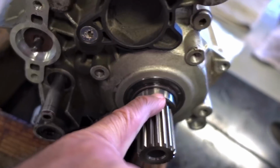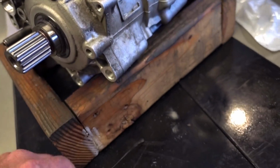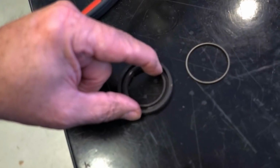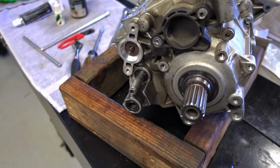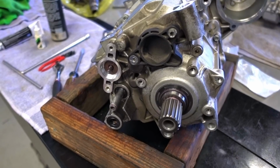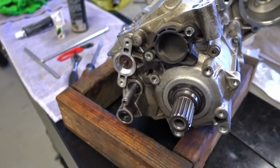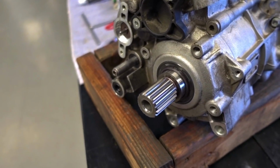The inside of the seal, that red you see, is a long-lasting kind of treatment they give them. Well, when they flip, it knocks the tensioning spring that rides inside the seal. So that spring is now laying on the shaft inside there, and it damages the seal to get it out. So I can't pull it out, fix it, and put it back together. It caught that sharp edge of that thing. Man, and I know better about those things, and well, I just didn't pay attention.